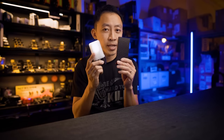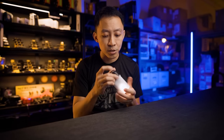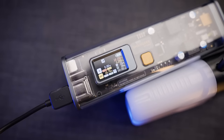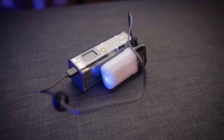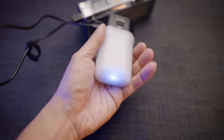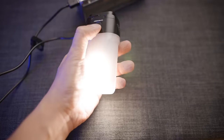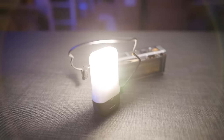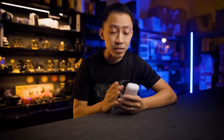The last game-changing part: because the LR70 has such a huge capacity at 10,000 milliamp-hours, it's essentially a power bank like the Carbo 10K or MB10K — so they made it one. This is airline approved and can charge in and out via the USB-C port with 18W QC and PD fast charging, zero to full in just 2 hours 50 minutes. To tell if the battery is full, there's a built-in indicator on top — tap the button when the light is off: three blue flashes means over 50%, two flashes means under 50%, and one flash means 10%, so it needs charging.